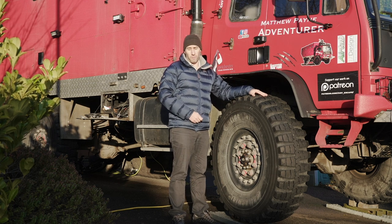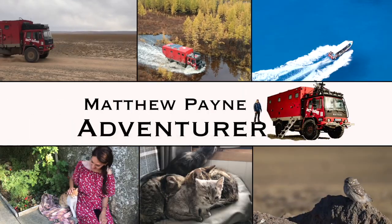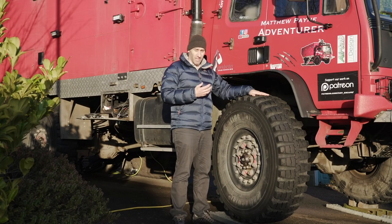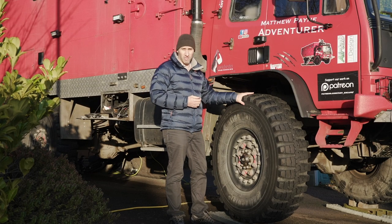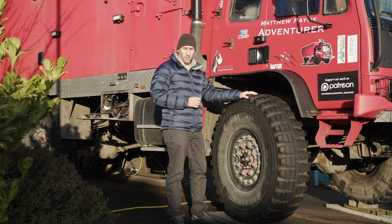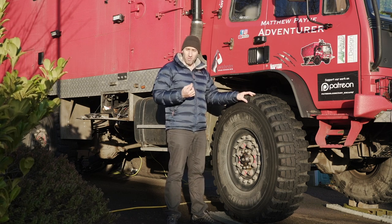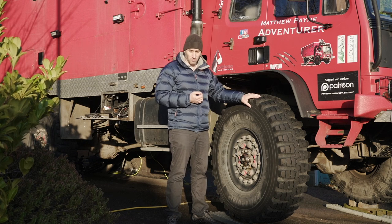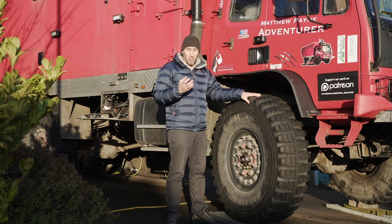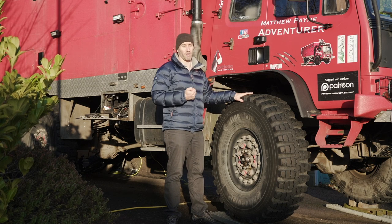Last week's video was on wheel safety, and today we're going to talk about tires. It's very easy to underestimate the dangers involving tires of this size. Ordinary car tires average around 30 to 32 PSI, but tires like this you're looking at 90 to 120 PSI, so they pose significantly more danger if there was to be a failure. To give you an idea of the destructive power, I'm going to show you a few video clips which will help you understand why we have to be so cautious, especially when inflating them.